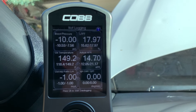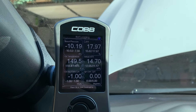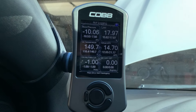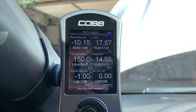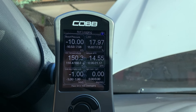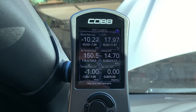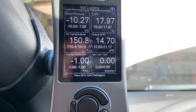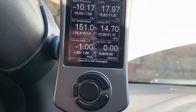If you don't have an ethanol content sensor, the fuel trim gauge can show you that. Also, air to fuel ratio is a good thing to monitor — I've never had issues with that but you should monitor it anyway. Around 10 is running a little bit rich, and 14 is where it should be normally. When you let off the gas it can go all the way up to 40, but you don't have to worry about that — it doesn't run like that when the car is actually under load.